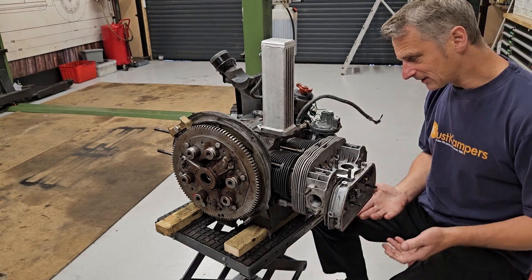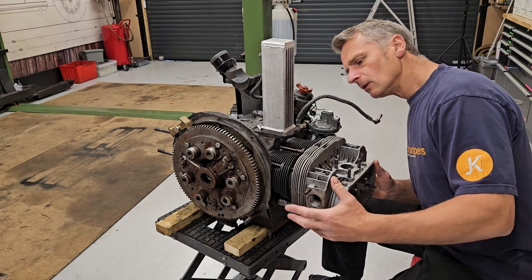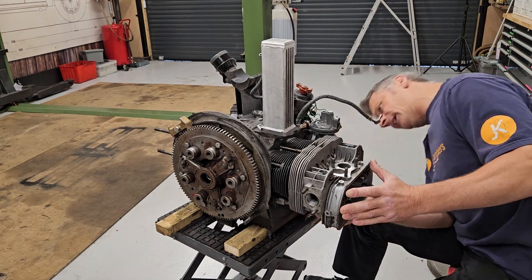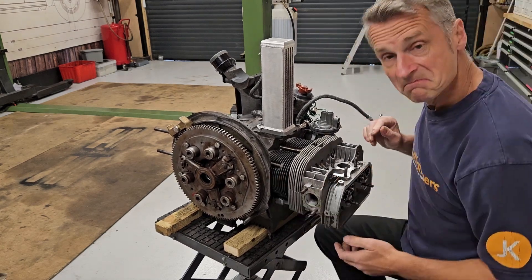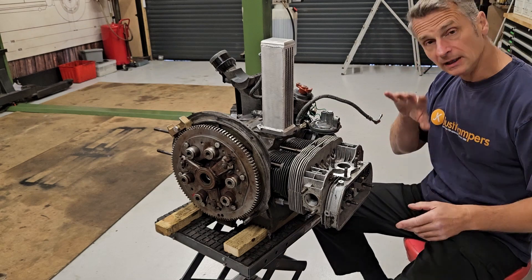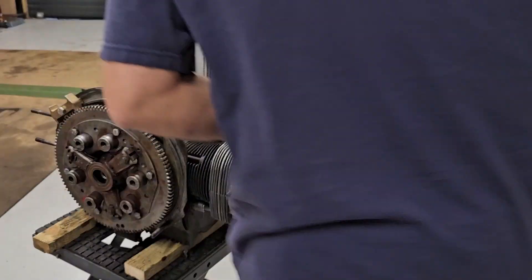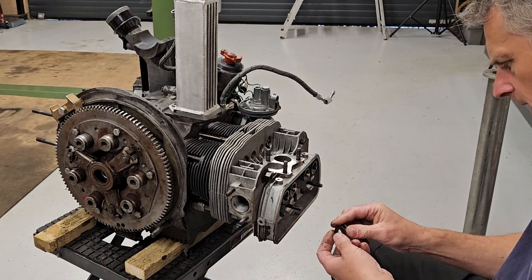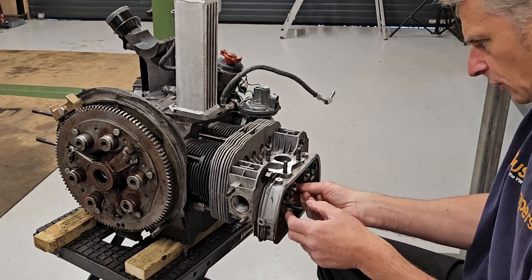The fiddly bit: I've got all four tubes in place — they're not sat home yet, just in limbo. Now we're gently walking the head in, making sure the push rod tubes sit in position correctly in the cylinder head and in the block. We can get some bolts on and start gently nipping it up, nice and evenly — once it's home we can do the correct torque setting. Getting all the nuts and washers in place first, then winding it home, making sure especially those push rod tubes are located nicely and stay nice and straight.